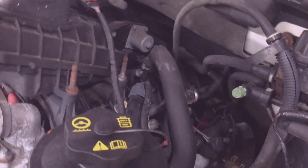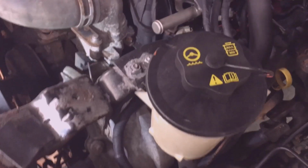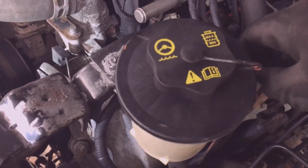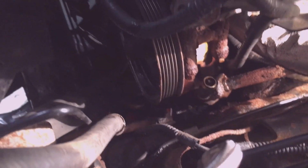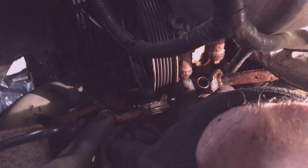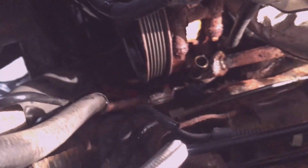I can take off the 3 8mm mounting bolts on the reservoir. Two on the back, and then one on the left side. The reservoir out. Give me a little better access to the 10mm head size pump bolts.